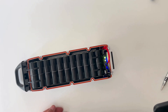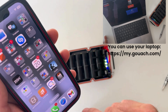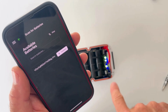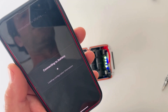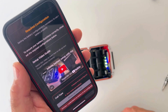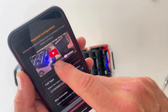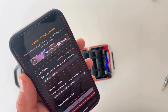To configure the battery, you need to use the MyGouach app — install it from the app store. You'll find the battery scan menu and you can scan for a battery. Connect to yours — sometimes there's a little connection glitch, so make sure your antenna is well plugged on the BMS. Since it's never been set up, you'll see a prompt explaining how to set up. This is really important: set which cells you are using.